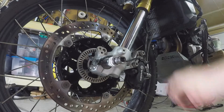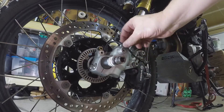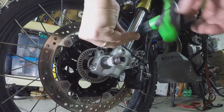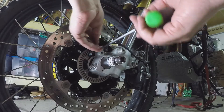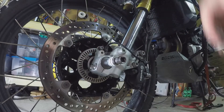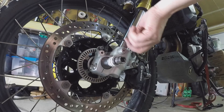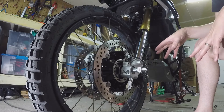While I'm here I'm going to go ahead and do the ABS piece - there's no reason not to at this point and I'm afraid I'll leave it to chance later. This had some thread lock on it so we're going to do a little blue thread lock. This is a T30. I'll insert the ABS sensor in there - it's got a nice little drip-loop sort of feel to it, the way it was taken out. I don't have a torque spec for this particular bolt and it's going into a sensitive electronic item with a plastic housing, so I'll make it more than snug but not give it any real big torque.